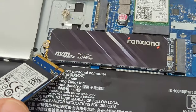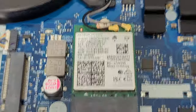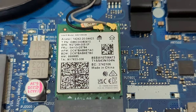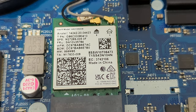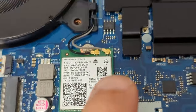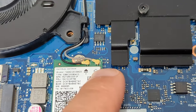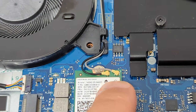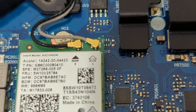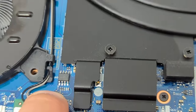Here you can see the 2280 long drive. I also upgraded from a Wi-Fi 5 M.2 card to a Wi-Fi 6E card. The main specs are whatever. I asked ChatGPT — black is the main antenna (two), gray is the auxiliary (one). If you put them in reverse order, you will get into big trouble. You can also see it labeled: main two, aux one. This is the basic procedure for these antenna connections.